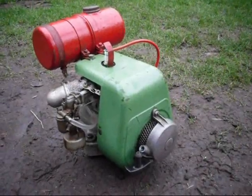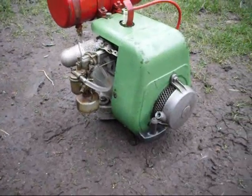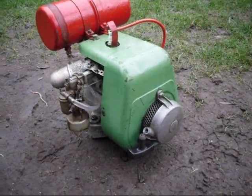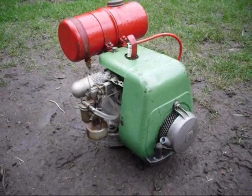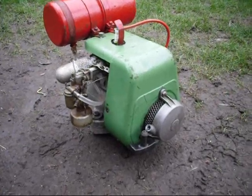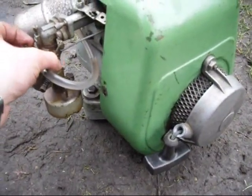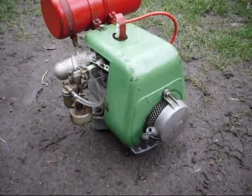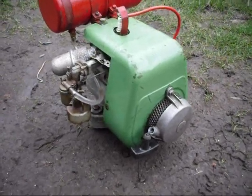Well, here we are - I've got the engine all back together now and fitted the fuel tank. I've set the carb up again because that new filter was changing the mixture and strangling the carb a bit. It's ticking over very nicely now. Obviously it all needs repainting but all in good time. I think there's a slight chatter from the cowling so I might need to sort that. But the knocking that was happening before was actually a loose flywheel, so I'm glad I checked that.